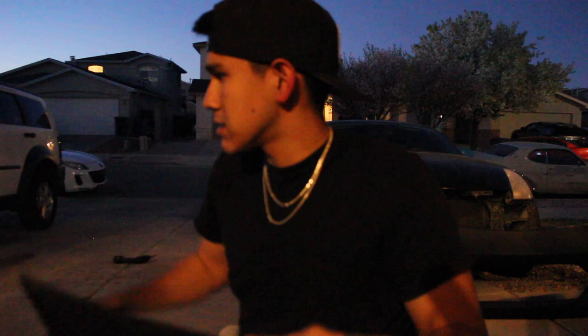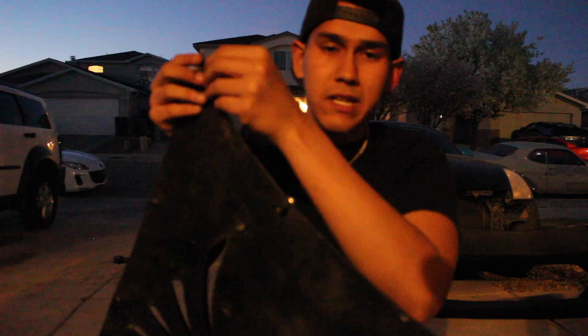That's why I'm using the hardware on the fenders of the car. It was like $200 for all the hardware for this car, but it's worth it. Looks sick. The way I've seen people do this in the past is they fit each hole that they drilled out with this first, and then they fit the nut on the back, like how I have this one set up already. You tighten it, put it in the hole, and then tighten it and it sticks. So that's what I'm gonna go ahead and start doing.